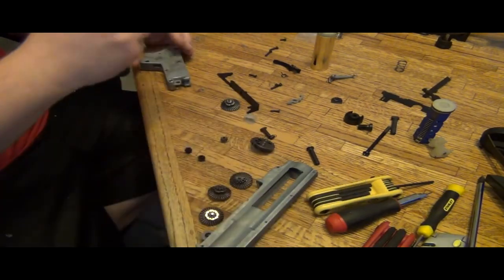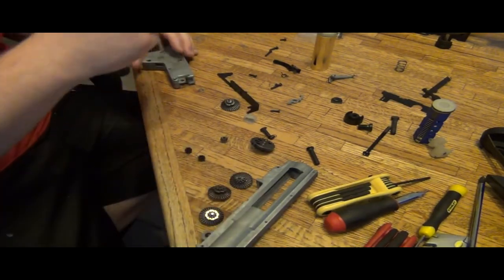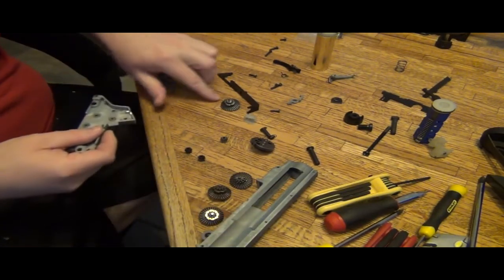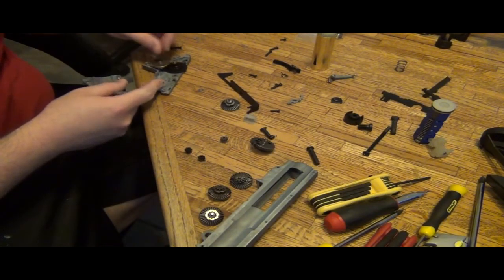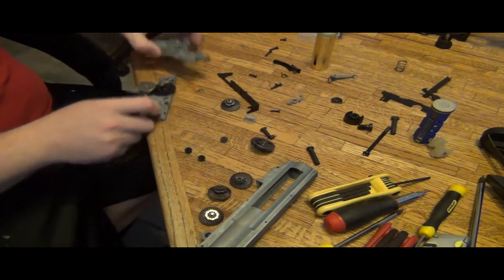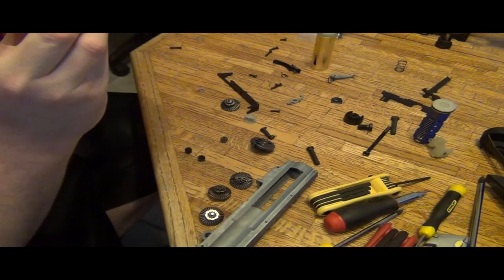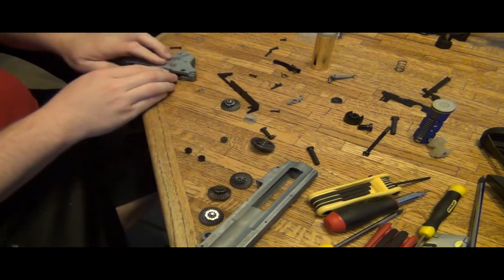Might as well just remove the spur movement. There's barely up and down movement for the bevels. The bevel's good, but let's remove the spur movement so it doesn't come up into the bevel. Go with a 0.2 on top of the spur, and put both of these back on here. If you are wondering, the tops of the axles with the shim should be all flat and level to one another. Too tight. Too tight!